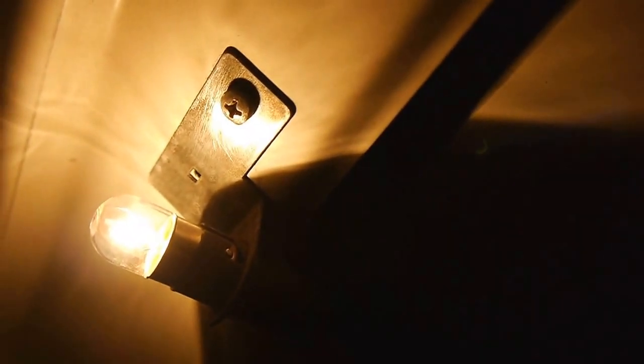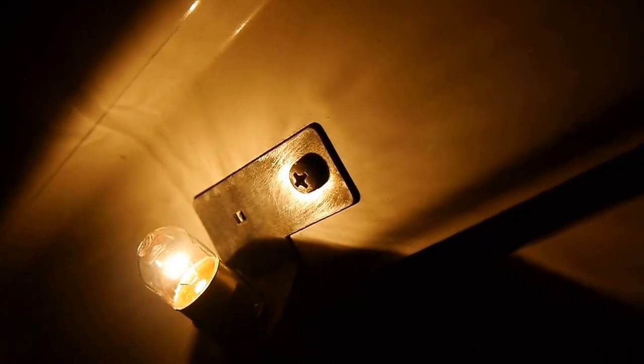I didn't have to cut any wires. The only thing I had to do was pull the light bulb out from inside here. See this wire — the little tab right there? When you unscrew this unit, you bend this tab down away from the unit, and this whole assembly pops out. You can pull everything out — watch out, it's mercury, it's dangerous. Just clean the tips with some 1000 grit sandpaper. Clean your ground over here — I cleaned the screw, I ground on both sides. I used 80 grit, then 1000 and 2000 grit.